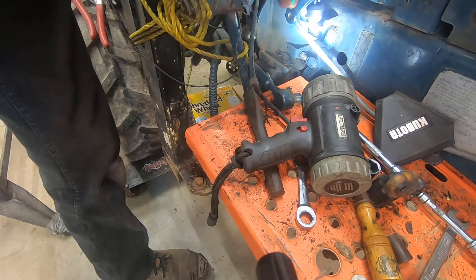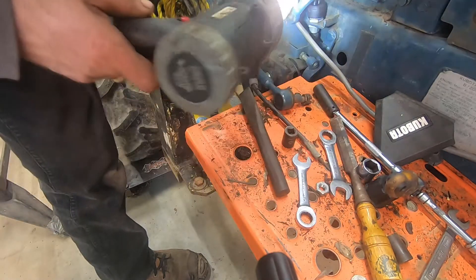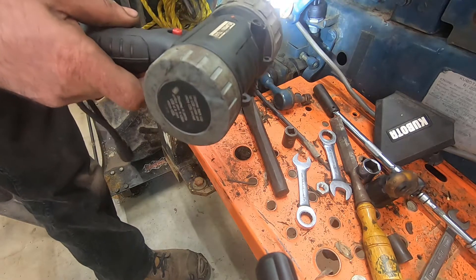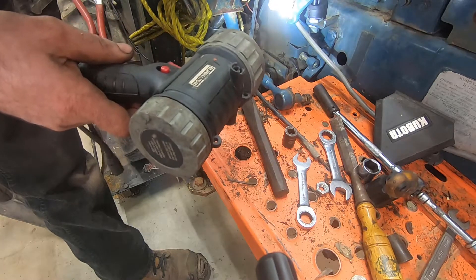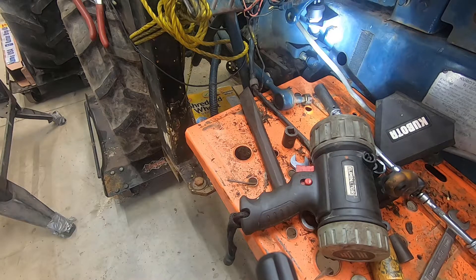The wires you've got to hook them up the same as they were disconnected. You've got one wire that goes to the starter solenoid and another wire that goes up to the ignition — I'm not going to cover that, just plug them in where the old wires unplugged. So that's how the clutch sensor switch is installed. If you like my videos please subscribe, and good luck with your do-it-yourself projects.